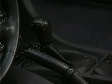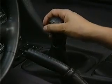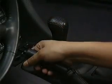Now let's take a detailed look at the entire opening sequence for the retractable hardtop. Under normal circumstances, the hardtop is in the fully closed position. The quarter windows are closed. The door windows can be in any position. The tonneau is closed. The hardtop storage area is empty. The engine is idling, and the transmission is in park for an automatic or neutral for a manual, and the parking brake is applied.